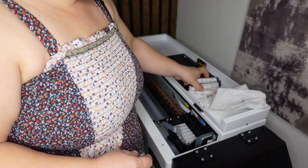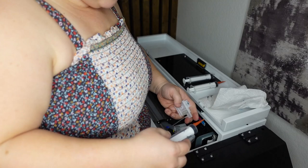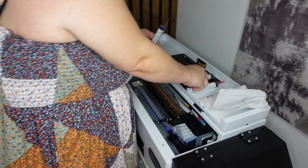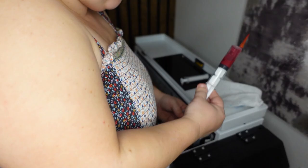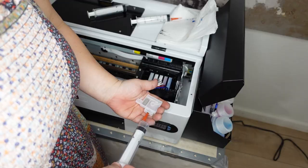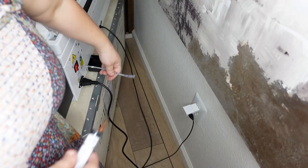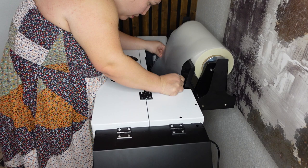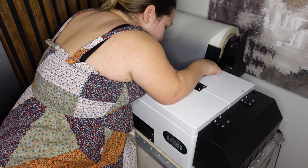I'm almost done transferring the inks — just screwing the last lid. Now I'm going to wire the ink through the tubes using the syringes that came with it, taking a couple of milliliters out of each and pouring them back into the container so I don't waste any ink. I'll follow this procedure for all the colors, including the two white channels. I just have yellow and black left. I'm also wiring the waste ink line in the back of the printer, setting up the roll holder, and putting the paper through it — just the final touches of assembly.